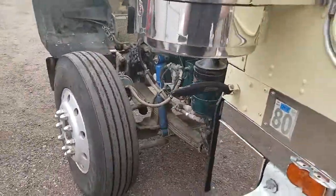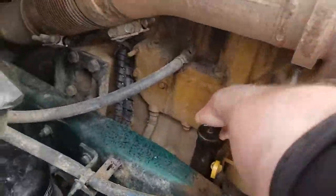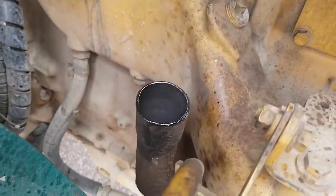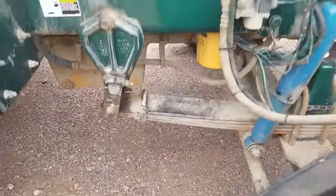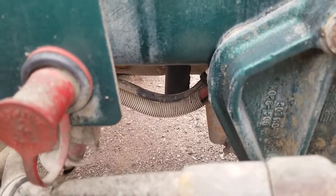Now it's been running for quite a while before I took this video so I can show you the blow-by accurately. It's got some blow-by. I don't think anything unusual, but I'll let you be the judge of that. So it's showing blow-by. That's kind of an extreme example because I'm going right out the fill cap, but that's the way to check them. If you look at the blow-by tube, there's your blow-by tube back there, and you don't see that much blow-by coming out of there.